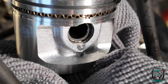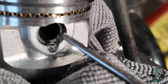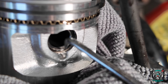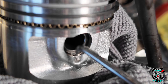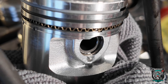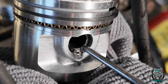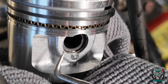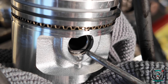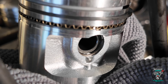Top tip time. You probably already know this, but the gap in the circlip does not go in the gap on the piston. In the GSXR engine build video series, I show my technique for getting these circlips in using the cutaway and the shape of the piston as a sort of wedge. You can almost get them in just with your fingers and then finish them off with a little pick. Then you've got to rotate them so the gap is not in the piston gap.